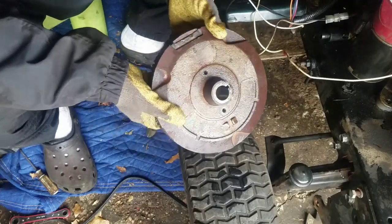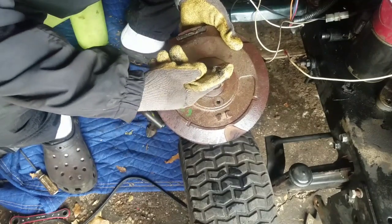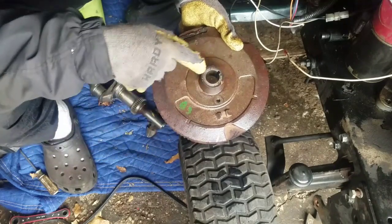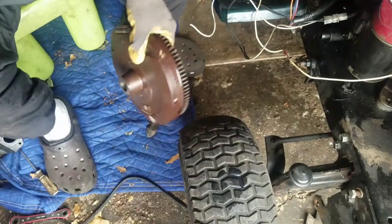There's like one type of flywheel out there where the keyway, instead of at 2 o'clock, is more pointed towards noon. It's around 1 o'clock. That's the one that I need. But I'm not spending $180 to get it. It runs right now, and it runs well.